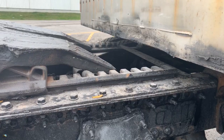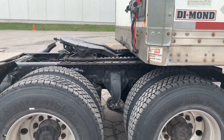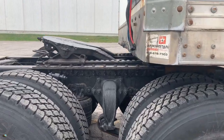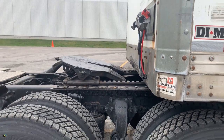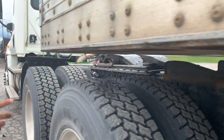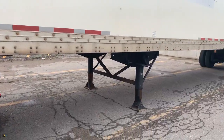Put it in neutral and make sure you put the parking brakes on. If you don't put the parking brakes on and step outside, the examiner will come inside and close that valve — and that would be an immediate test termination. Come outside: your fifth wheel and trailer are now separated. The trailer is stable and secure on the landing gear — it's not falling anywhere.